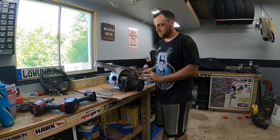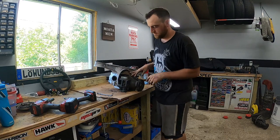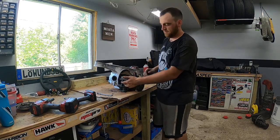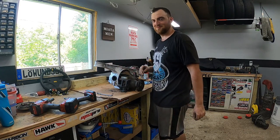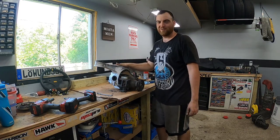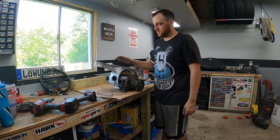There you have it — the basic assembly. I torqued everything to 17 to 20 foot-pounds, except for this one. You can't really get a torque wrench in there without hammering it out, so we're going by hand tight, which feels right. This would be good to throw in the car right now if I weren't moderately OCD.